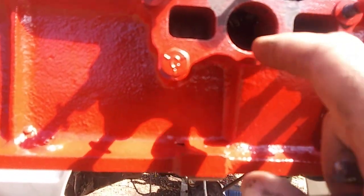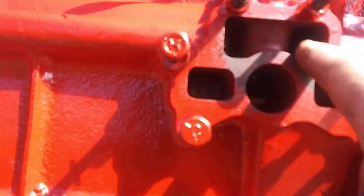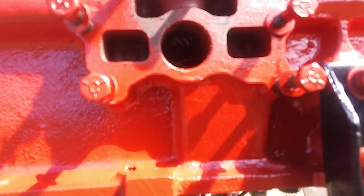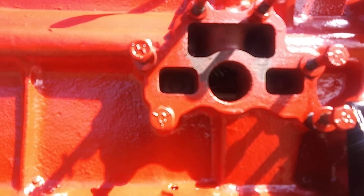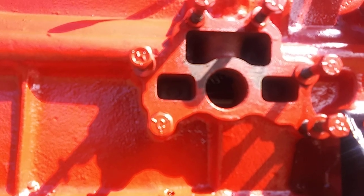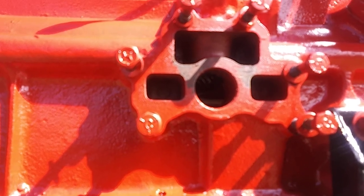I've never seen any of the oil pumps use that side anyway. These two up here — there's a port in this corner and a port in this corner — and they've both got sharp edges. I'm gonna be smoothing them out. I won't be able to videotape me working on it because I don't have a tripod yet, and you probably don't want to watch five or ten minutes of just grinding away.